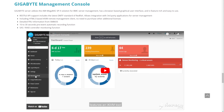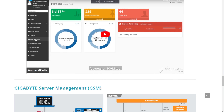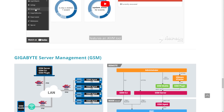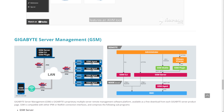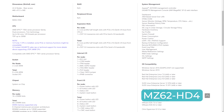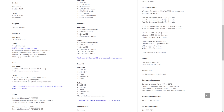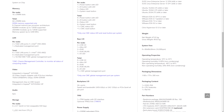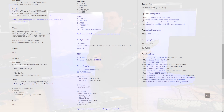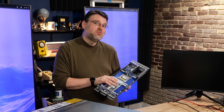These high-density chassis have an optional accessory from Gigabyte where you can manage all four nodes from a central control interface. Gigabyte offers software and customizations if you're a large enough customer. There's a separate network interface that's part of the chassis giving you remote console and control of the entire chassis. The motherboard is the MZ62-HD4, and this is Rev3. You've got to be careful with Gigabyte motherboard revisions - from Rev1 to Rev2 to Rev3, CPU support changes, BIOS versions matter, Redfish, etc. It's pretty typical of enterprise boards, but you've got to dot your I's and cross your T's - sometimes even support is confused.